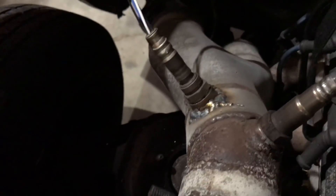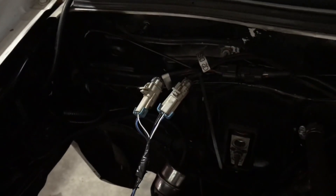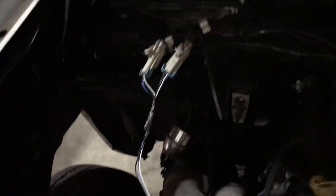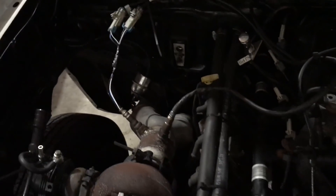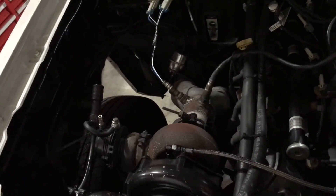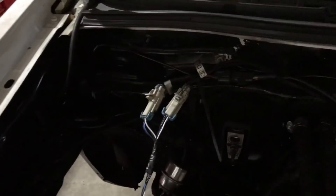I combined the O2 sensor wiring, because I put two O2s in the downpipe anyway. I did not prep that very well — obviously it looks terrible, but let's get over it. I split the wiring and figured, why wouldn't it work? And it does work. I just modified the computer a little bit and it seems okay. Other people have said it's no problem, so I'm going to iron out the results and hand them out. It's a single O2 sensor signal going into both O2s, because the computer needs to see both O2s working.